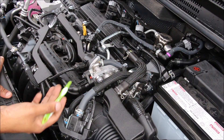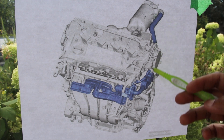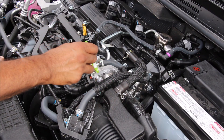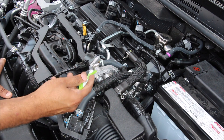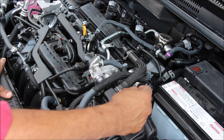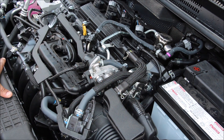Next up we have the EGR system, which is in place for pollution control. It takes those exhaust gases, cools them down, and then brings them back into the intake. Here we have the EGR valve with its own tract that leads back up into the intake. Behind it we've also got the EGR cooler, so the exhaust gases have to pass through it to get cooled down by liquid coolant before going back into the intake to get re-burned.